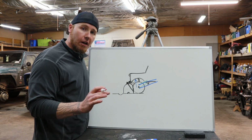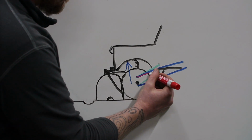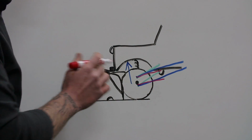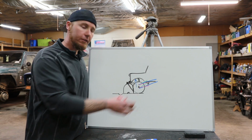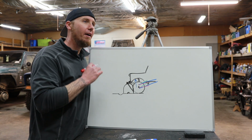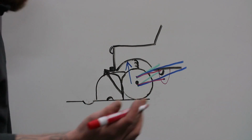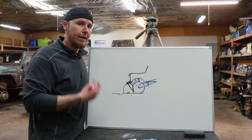There is something else I haven't talked about yet, and that would be lowering where these arms mount. So you could take your upper arm, you can take a lowering bracket of some kind, and mount it here, and this will help a ton with a short arm suspension system because it's going to locate your short arms to the middle of the arc instead of on the lower side of the arc. This is going to change the way it rides. It's going to be much more of a factory feel, but you also will have some big bracket that's hanging way down like this. And that could be a big deal or not a big deal based on how you wheel and the type of terrain you're in.